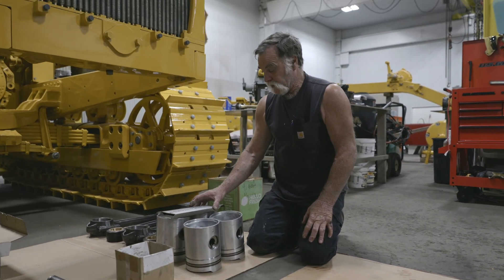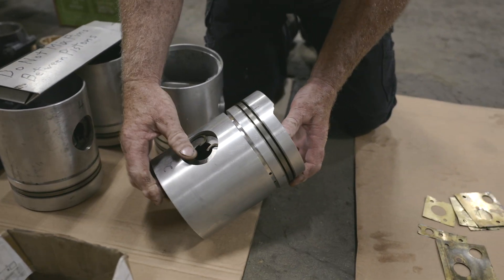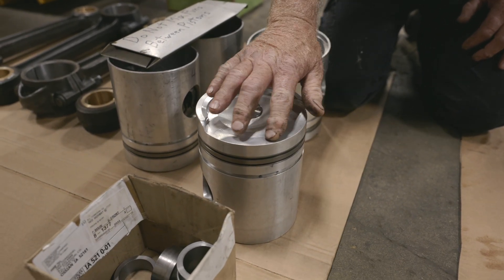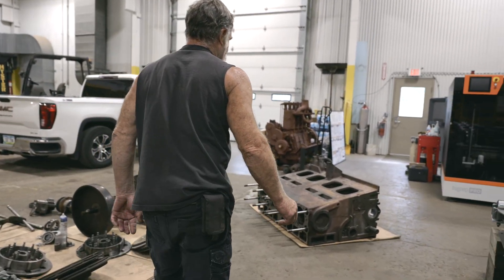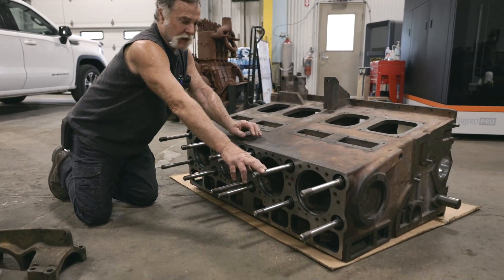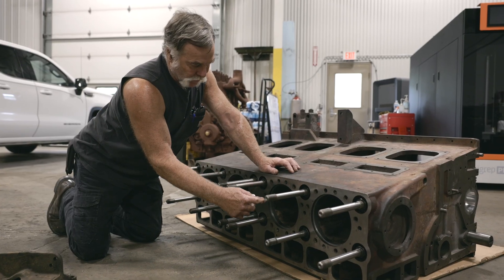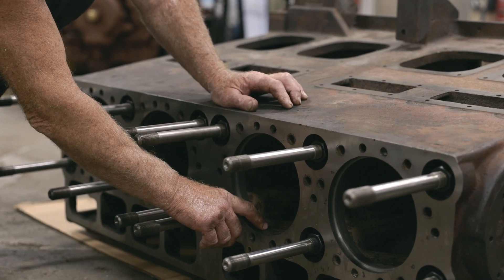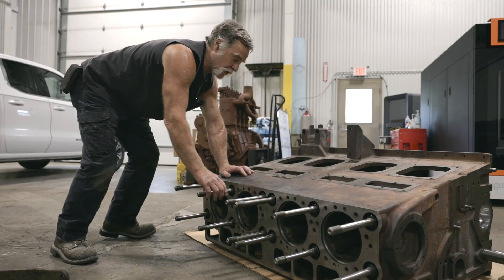We have our pistons, and we ended up milling a lot of material down off them — they're also balanced. We've got slugs in the middle of our wrist pins to keep everybody the same weight. We ended up milling down from the top with what we got made so we could come up with the right compression ratio. Craig walks us through the heart of this beast and shows exactly where each piece will be surgically stitched back into place. All the new studs are in place now, the block was decked, a line bore was done, and we put new sleeves inside with the O-rings and stood the block out to accommodate the sleeves.